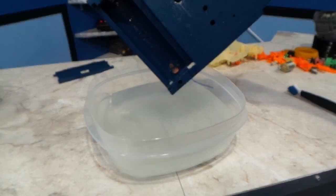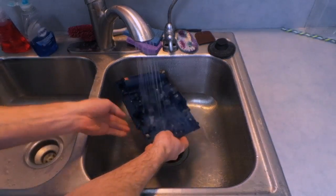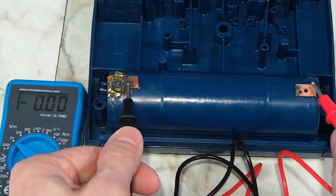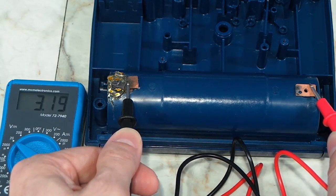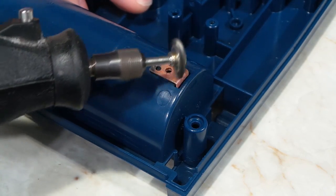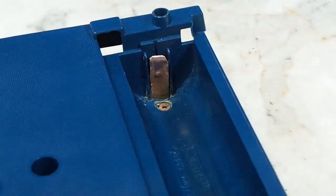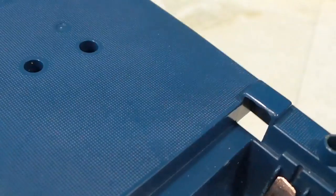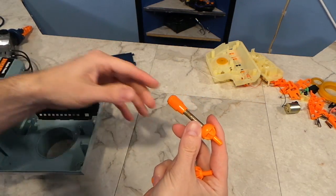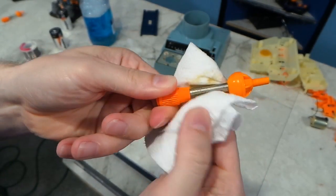Here we are 24 hours later. The terminals look a lot different now, although they still have a sort of rusted appearance. I decided to throw some batteries in there and test it with a voltmeter, and it does appear that they are making electrical contact now. I decided to polish them up just a bit better, so I got out my Dremel with the wire brush on the end — this cleaned the metal right up. I was also irritated at the appearance of the little joystick controls — they were rusted. I just tried scrubbing with alcohol and a paper towel, and surprisingly they cleaned right up.